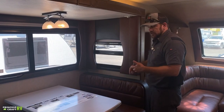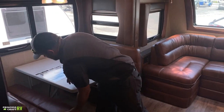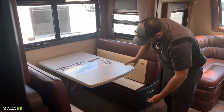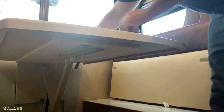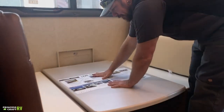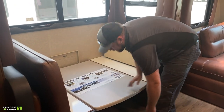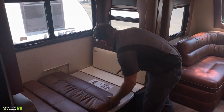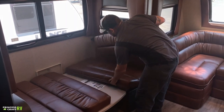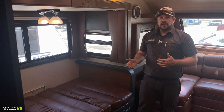This also makes into another alternate sleeping area. Get your cushions up out of the way, then underneath the table there's a latch lever — tip it down so it's pointing to the ground. Put weight in the middle of the table and push straight down. Once it's all the way down, reach under and fold the lever back over. Slide your big cushions in, bring the back pieces to the middle, and now you've got your alternate bed.